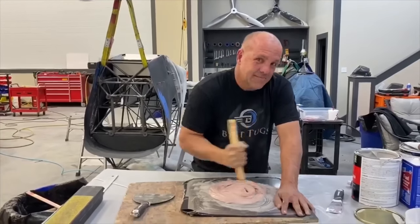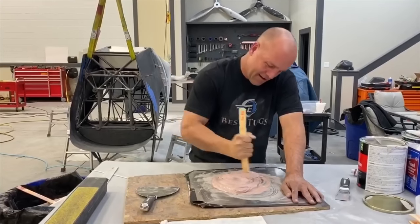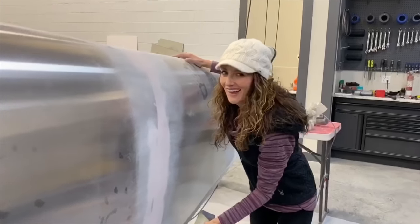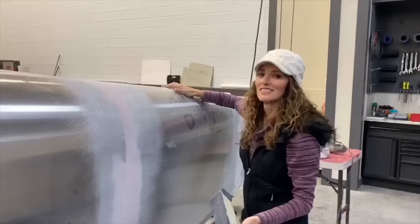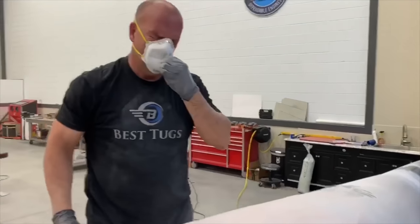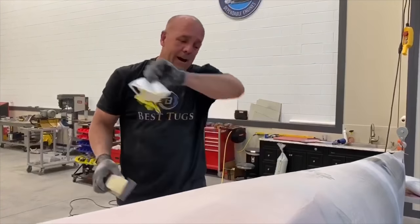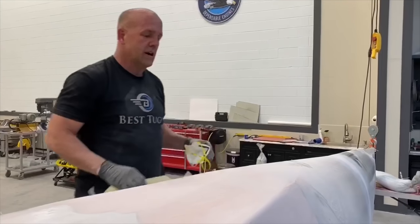You put 95% of it on and sand 80% of it back off, but a little closer each time. My wife came to say hi, so we gave her 60 grit paper and put her to work. This is not hard, but it's really hard. I'm a lucky guy. This is why we do bondo on the mold now - I probably got over 10 pounds of mud on here but I'm getting the exact shape I want. When we pull the carbon fiber I'll have almost no body work.